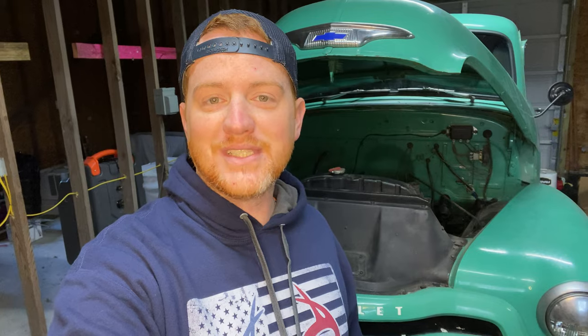This truck does not run off of a typical 12 volt battery like modern cars. These much older vehicles — early Ford tractors or really any tractors, old cars and trucks — ran off a 6 volt battery. The whole electrical system is designed for 6 volts. The 12 volt upgrade will give us better starting and make it easier to get parts at O'Reilly's or AutoZone.